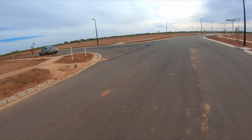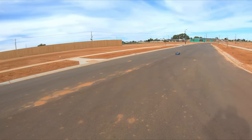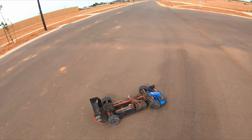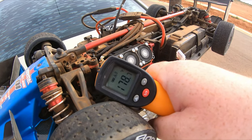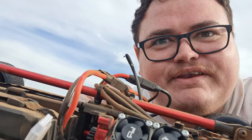Guys, I know I'm talking so much but it's just so much fun. I definitely want to go 6S and probably gear down just a touch, especially for bashing around like this. I bought an on-road RC car — I'm trying to keep this one clean. Air compressor time. The motor is starting around 185°F, down to 160°F — that's not too bad. And the ESC is at 130°F to 140°F — also not too bad. I absolutely love the Arrma Limitless. What an absolute blast. It's definitely my favourite right now — maybe that's just novelty. We're going to try it on 6S and bring it out again for a bash, and eventually I will see how far we can push this motor on 8S. That is it from us — catch you guys in the next video. Peace out!